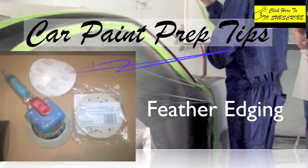Now, we don't want to use the interface pad for feather edging, because feather edging is basically the process of leveling out the paint surfaces. Anytime you're leveling, a harder surface is going to work better. Now this interface pad is real soft, so that's not going to work well for that. That will work well when we do our final sanding, and we don't want to get marks from the edge of the DA digging into the paint and causing little swirl marks or anything like that. That interface pad works excellent for that. But for feather edging, just use the DA and sandpaper, and that will level out the feather edge better than using the pad. So anyway, then we're going to go out each layer about 1/4 of an inch.